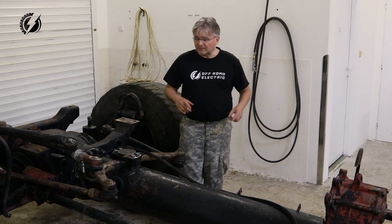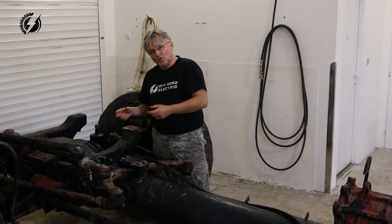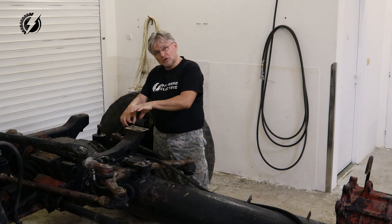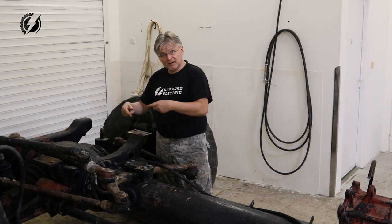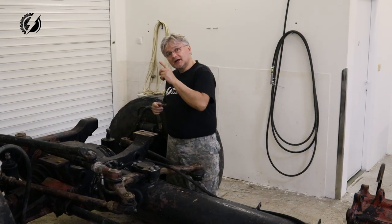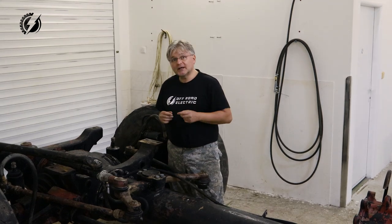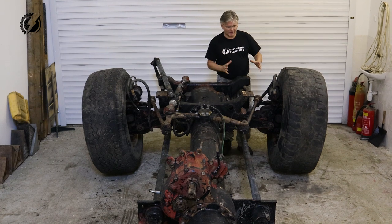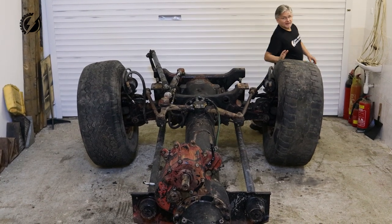I would like to make it shorter because it would limit and spoil the ground clearance. Another option is that each axle has two outputs — one through a shaft for one wheel, and the second wheel is over the tube which is over the shaft. I can put a gear on each output and run two sets of three gears. In that case, each motor will run only one wheel. Which option I'll decide on, I don't know yet — I will let you know.